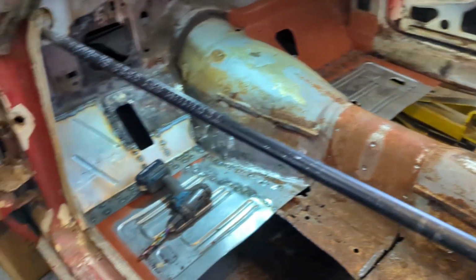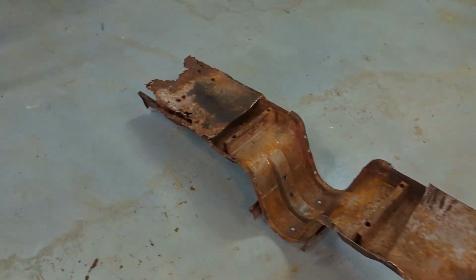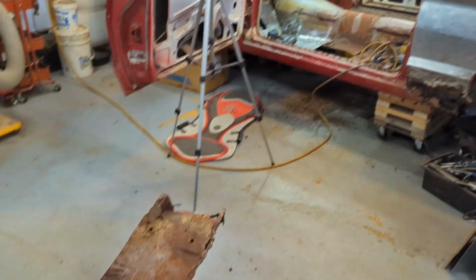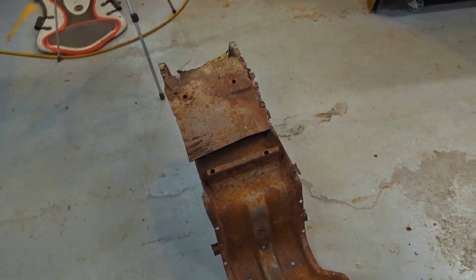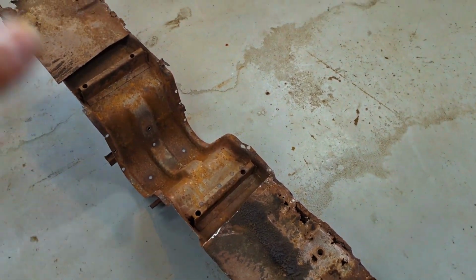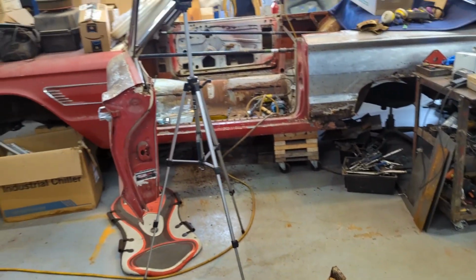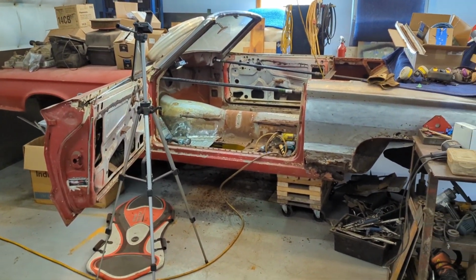All right, guys. I'm going to continue cleaning this thing all up. And next video, I'll be putting in the floor pans and probably show some of this cleanup. It's pretty straightforward. I'll grind off the old steel and re-weld some flanges on, and rust treat it and all that jazz, like I said. But that's it. The old car didn't break in half, so that was nice.